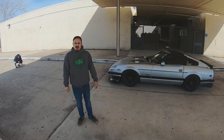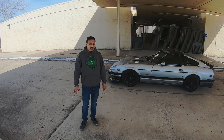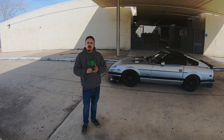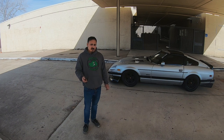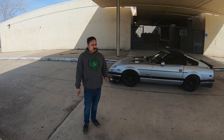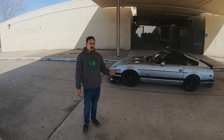We just got it back from Texas Trackworks for an alignment, and this thing is super solid now. Definitely worth the money for anybody looking to improve the feel of their 280ZX. Just to provide a quick recap: pretty much the only thing we still had to do was re-drill the mounting holes for either the factory splash shield or what would be your big brake kit — either from Arizona Z Car, Silver Mine, or Techno Toy Tuning. Those brackets don't line up with the Apex arms but they line up with the factory arm. I'm sure it's just a minor thing that changed in production.